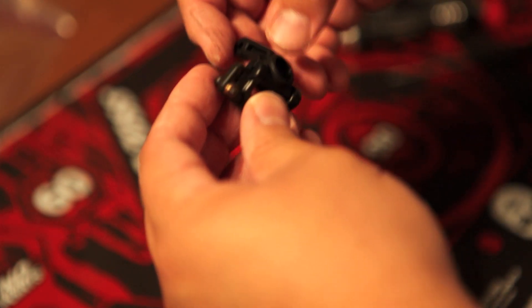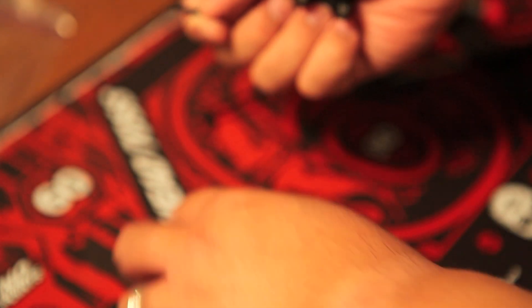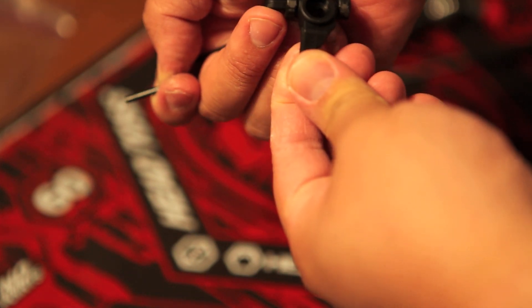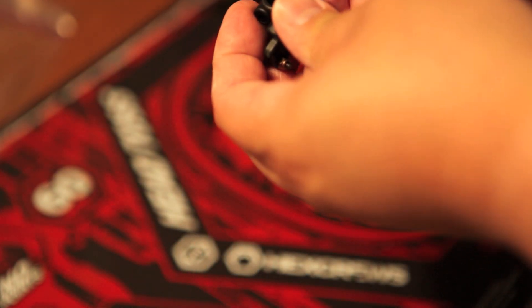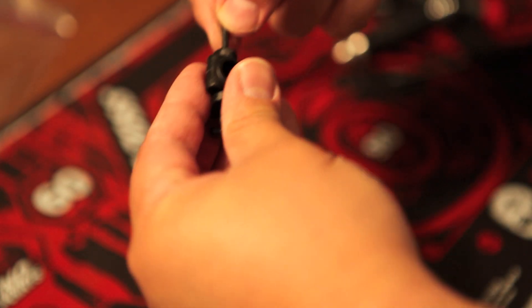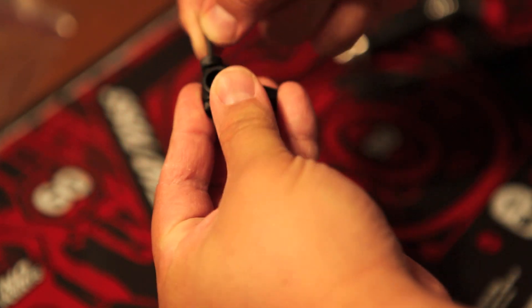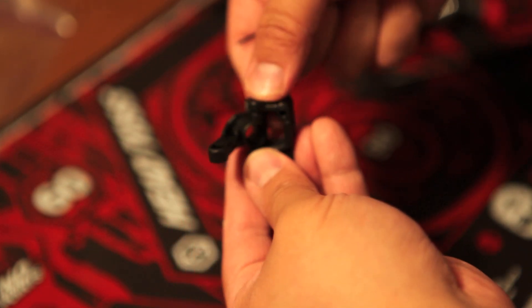Making sure that the king pin is fitting in. I still don't have the right size hex Allen wrench so I'm still using the stock hex Allen wrench that came with my RTR to screw it in — just a little out of frame there. I'm also going to thread in that hinge pin. It looks like it's fallen out, so I'm going to push that back in. It's taking a little time — the part is a little tight fitting, but once it goes in it should be all great.